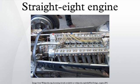The British Army selected Rolls-Royce straight-eight engines in the Alvis FV600 Armored Vehicle family. The Saladin Armored Car was a 6x6 design with the engine compartment in the rear, a 76.2mm low-pressure gun turret in the center, and the driver in front. The Saracen Armored Personnel Carrier had the engine in front with the driver in the center and space for up to nine troops in the rear. The Stalwart Amphibious Logistics Carrier had the driver's compartment over the front wheels, the engine in the rear, and a large load compartment over the middle and rear. The Salamander Fire Fighting Vehicle was unarmored and resembled the Stalwart with a conventional fire engine superstructure.